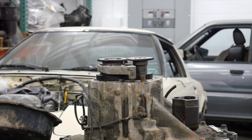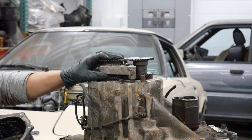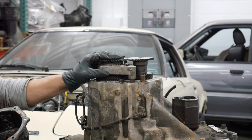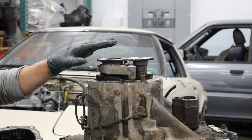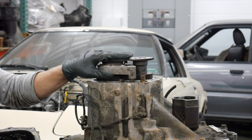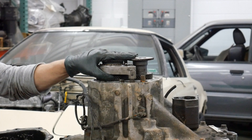It's a pretty simple process. You don't have to overtighten these 10mm bolts — they're just 6×1.0 threads, so don't go too crazy. There is a torque spec, probably in line with every other 6×1.0 bolt. If you have your vehicle at an angle like I suggest, let it sit for a few hours to let the RTV get tacky before you let transmission fluid back in and take it off the jack stands.